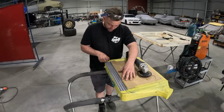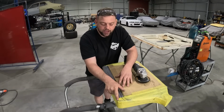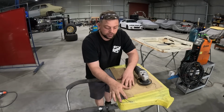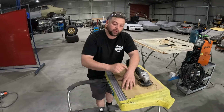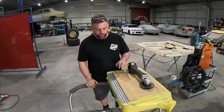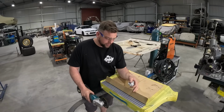So I'm going to cut straight down the middle of this, and then you'll see my texture mark goes like that. So what we're going to actually do is, instead of welding a cap on the end, we're going to cut that out, and we're actually going to roll the original tank around to make it shorter, so then we can weld that to the top of the header plate, which will be bang on that tube. So we'll cut this down, get it all in, and then hopefully it fits mint the first time and we don't need to cut it down again, but we'll get cutting.